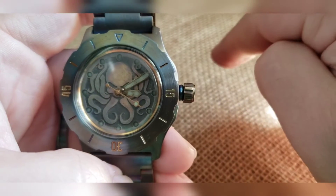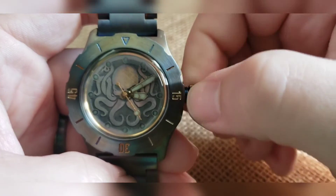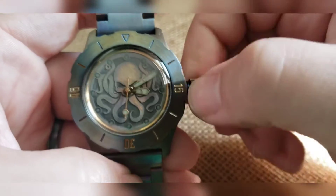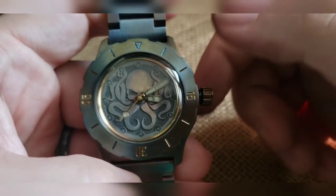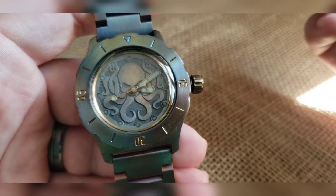A wind is a turn that way — turning it towards you doesn't do anything, but it's a lot easier to keep your fingers facing and just go back and forth. If you do this for four or five seconds, even if you're not very active, you'll keep time throughout the day because that'll be mixed with the rotor movement in the back. If you do it for closer to 15 seconds you're going to max out that 31-plus hour power reserve. You cannot over-wind it, so don't worry about that.